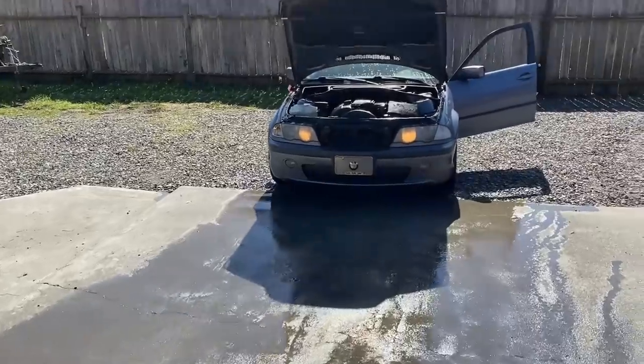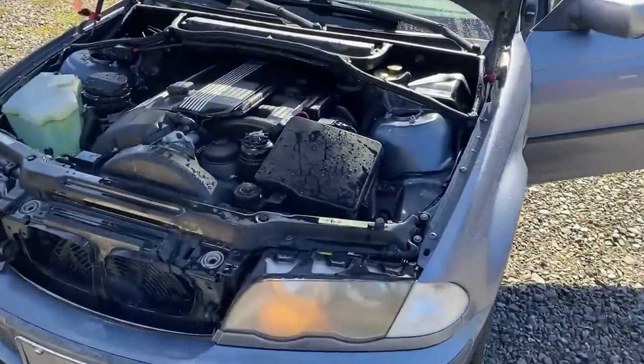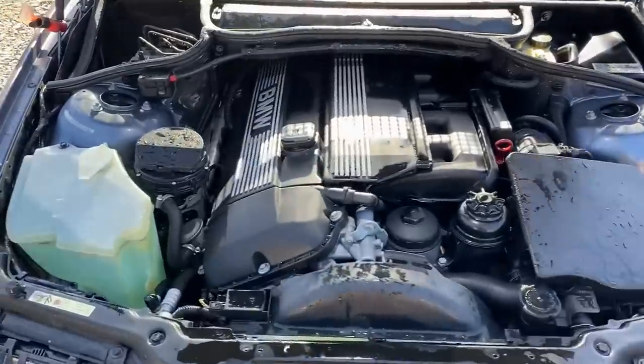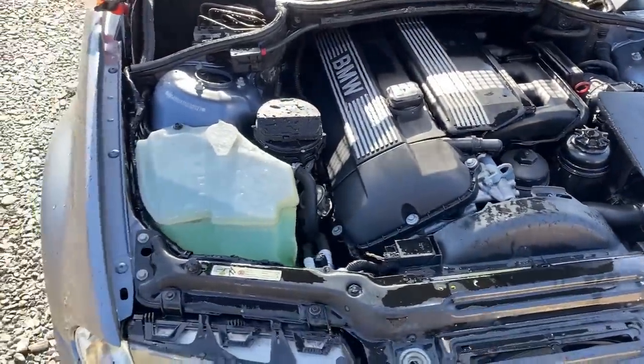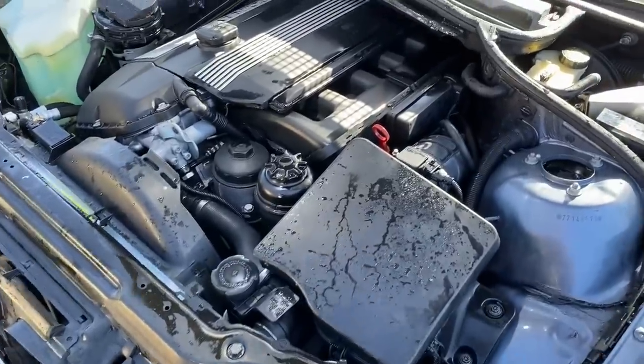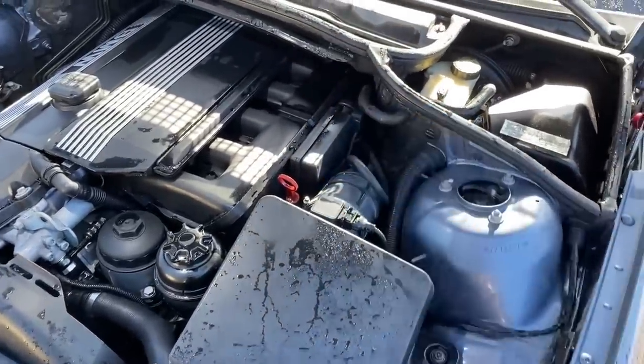Well, shoot, I just missed all the pressure washing, but she cleaned up real nice. I degreased the whole top with some Gunk foamy degreaser, pressure washed her down, got the undercarriage cleaned up pretty good too. I'm gonna drive her around today, although the DISA valve is making a bit of noise. I checked it with the stethoscope. Sounds like it's coming from the DISA.